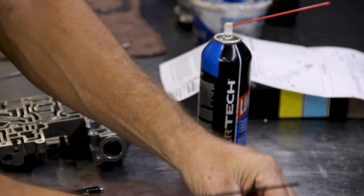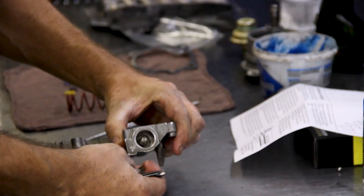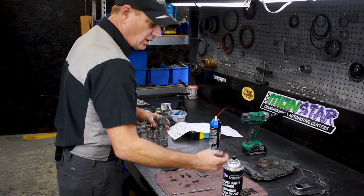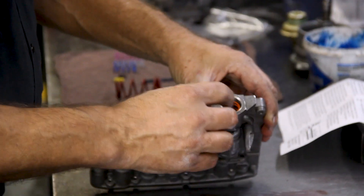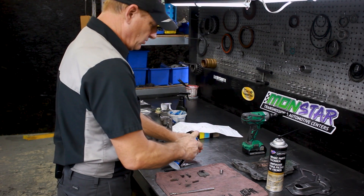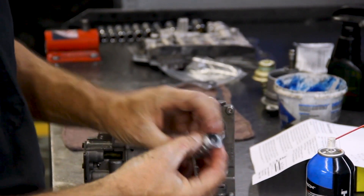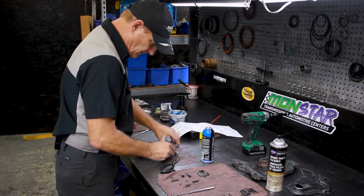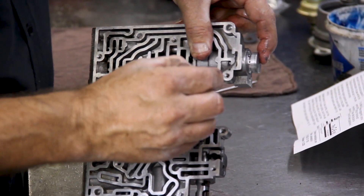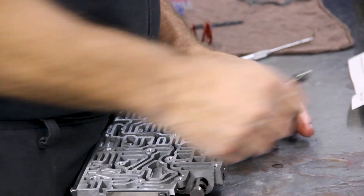Ensure that these components are clean. We're going to slide this valve in first with the shank facing out, then put the plate on. It will go down into the bore onto that assembly. Then install the factory black spring in the center — the smaller one — followed by the orange spring into the bore. Reinstall this valve back into the boost sleeve itself. Lubricate it a little bit with some trans fluid to hold it in place. This should go all the way down inside the bore and slide right back into the channel. Push it all the way down to the channel area, then reinstall the U-clip into that channel. The boost valve is now done. Check it afterwards by applying pressure to the back of the valve — the springs should push it back.